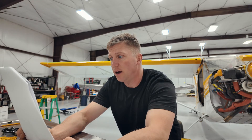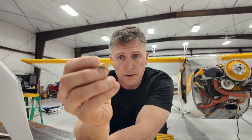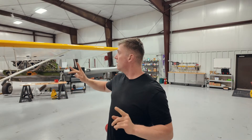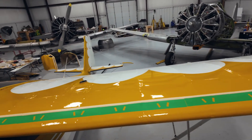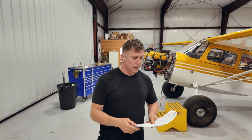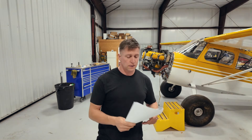The next step is to install the VGs. It's very important — you see that notch or contour in the front that goes forward? Don't flip them around, don't put them backwards. Now that I've got that side all done, I just need to get this other wing all marked out, get the string down, get the stencils on, and then proceed to cleaning the areas and putting on the VGs. Both sides are done and everything is lined out and matches up with the prints they sent. There's actually a print in the packet to make sure you're within FAA standards — take a look at that and make sure you're within those parameters.